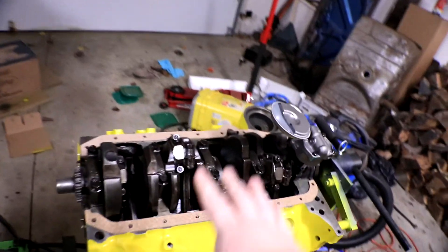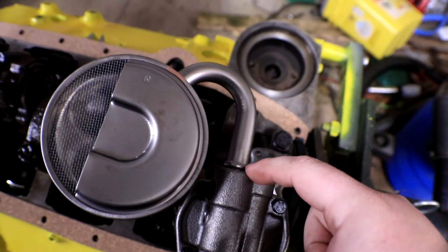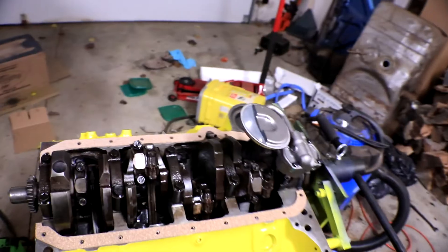That's set and secure where it is, but over time that oil pickup can and will likely move. Now for many, many years, that's exactly how people set it — just putting it in there, pressure fitting it, and basically hoping for the best. But nowadays we have technology, and a lot of us have welders in our garage that we can use to just put a little tack weld on there and make sure it won't go anywhere for its life. So I'm just going to be using this little flux core welder, and I'm going to protect all of this from the various splatter with some aluminum foil. All we're going to do is put a tiny little tack weld right there, and that will keep it from ever moving in the history of the engine.